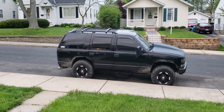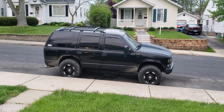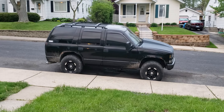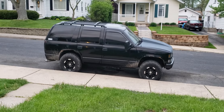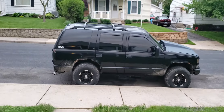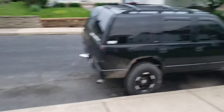I took the rear bumper off — you basically have to cut the frame on this to make it shorter for the roll pan to fit on. I got the roll pan mounted; it still needs trimmed up a little bit. I ordered this Silverado roll pan which I don't think is as wide, so it's still hitting the frame rails in the rear. I'm gonna have to get a hold of somebody to weld it for me, but I'll get you a rear shot of it.